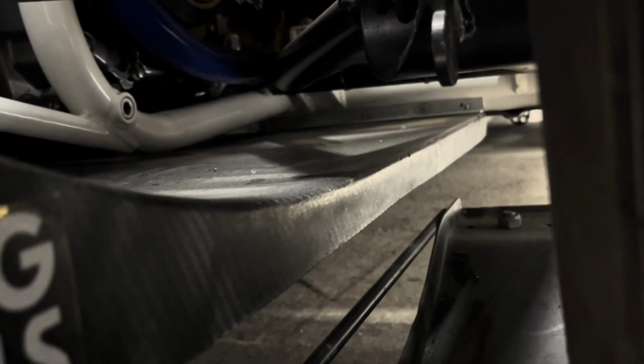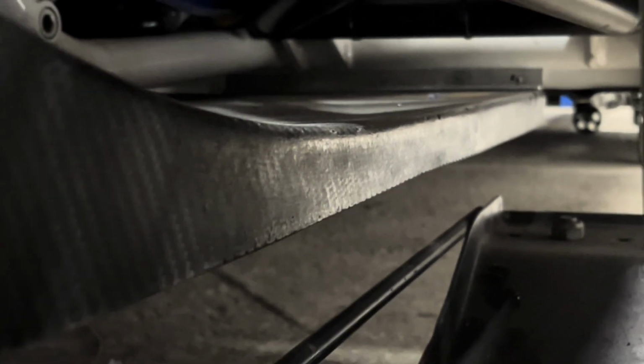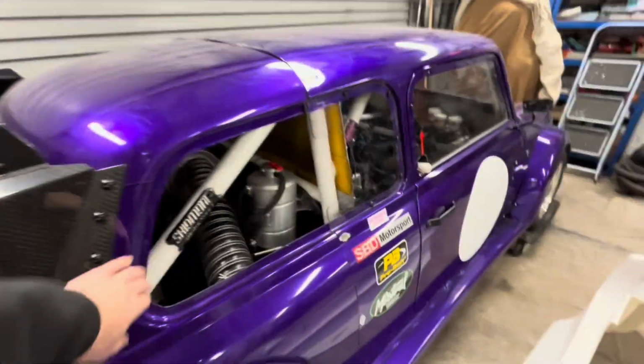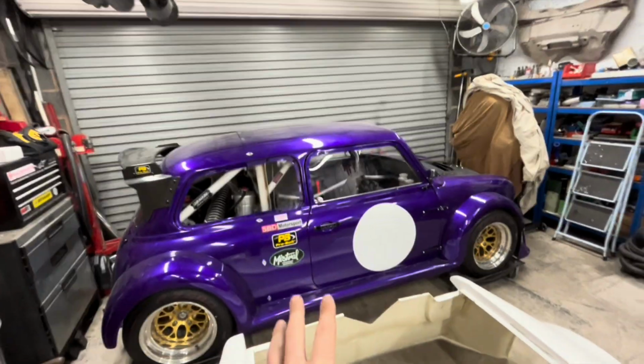Nice and simple. And then we'll all see it down there. But there is, well, you might just make it out. See how there's the aluminium bracket, the angle. Where's my finger? There. Well, running across the back underneath that tube is a bit of angle, which all it does is holds the floor up. So I've drilled and tapped it, ran 2 pieces of aluminium angle, drilled and tapped, that holds that in, and then this one, there's just 2 little brackets, a little bolt, which hold it to the back of this there. And honestly, the whole back of the shell now doesn't go anywhere. It's proper solid. So that's done. Fire extinguisher's done. A few odds and sods inside are done.